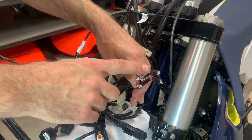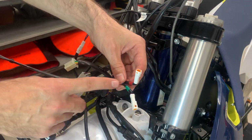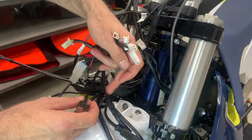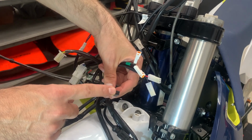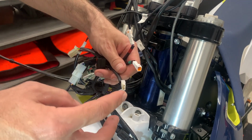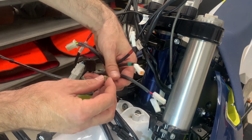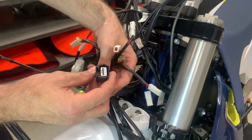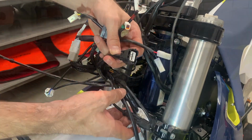This goes to the controls. Red and green are the connectors for the turn signals. Here we said this is the extension for the navigation. This is the extension for the original USB port. If you have the older version, you will connect the USB port into this extension. Here is the connector for the ABS switch, and here is a connector for the OEM speedo, and that's all.